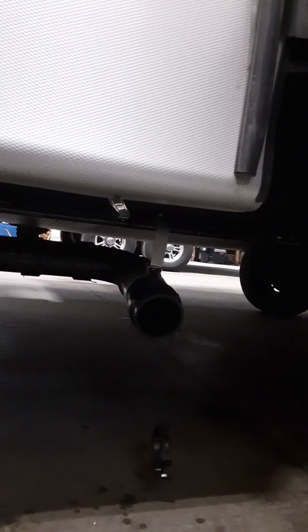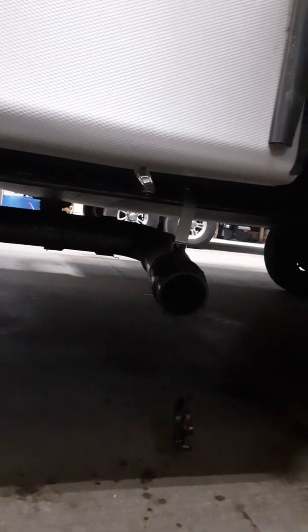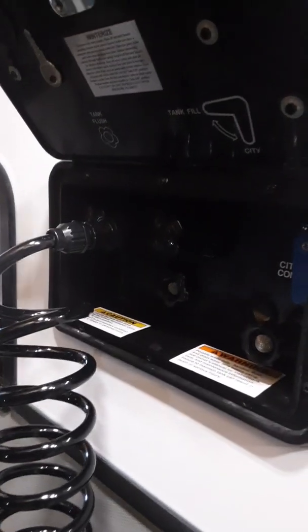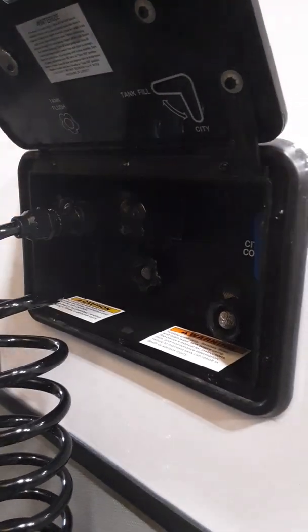Got it. Now, how is this flushed out, like when you want to clean it? You do it the same way. That's where that black tank flush comes from. So if you want to flush out the black tank and sanitize it, you're gonna hook up the water at that same spot I just showed you. Okay. So you're gonna hook up your water hose right to here. That's gonna push all the dirt that's stuck in the black tank through, and it's gonna come out there.